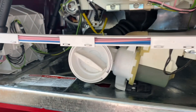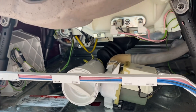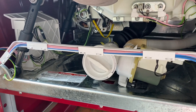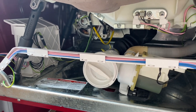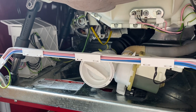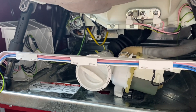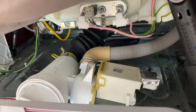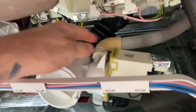Unfortunately, the last several times this has happened, I could usually just clear the code by unplugging the washing machine and then running a drain and spin cycle, and everything would work great for a little while. But more recently I can barely get through a wash cycle without it happening, which is not great. So I believe it's the pump that has gone bad at this point.